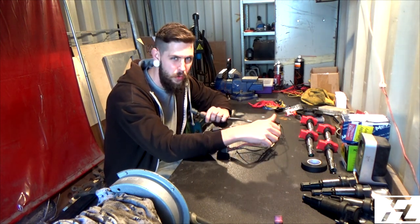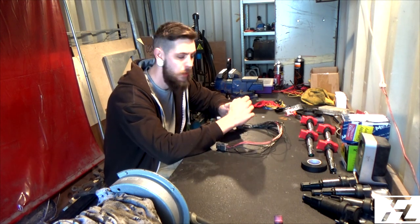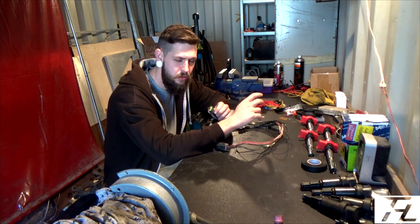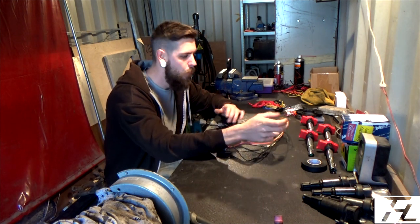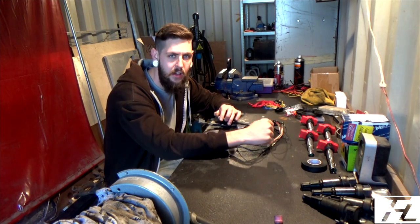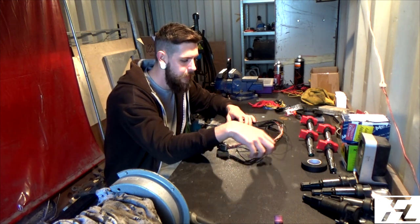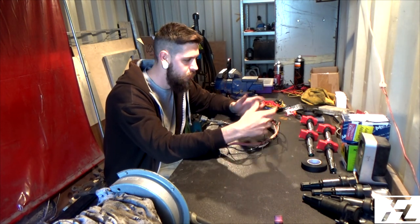I'm not going to bother with any of that, because every time I get my car mapped, the guy that maps my car says it's a bad idea to go off of a wire, because you can get interference and whatnot. He runs a separate lead off the top of the spark plug, a small HT lead that goes into the coil pack, and then he hooks his timing light directly to that HT lead. So he gets a clear signal all the time when he's timing the car. So I'm not going to bother with having any loops of wire hanging out to try and time it yourself.